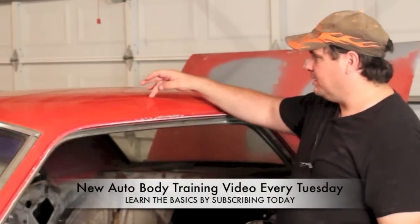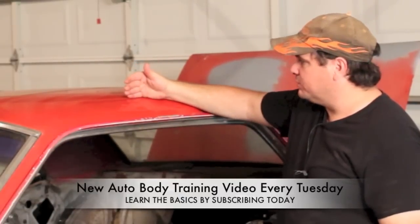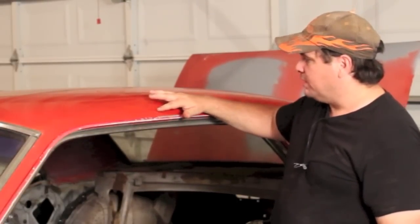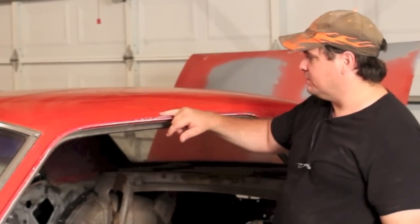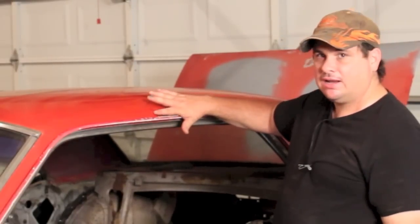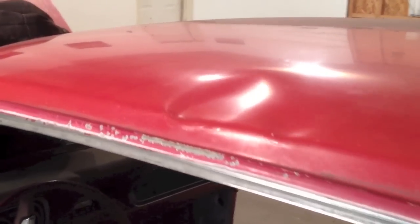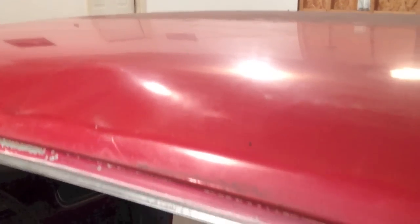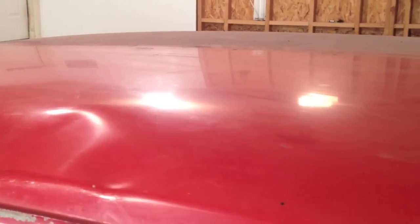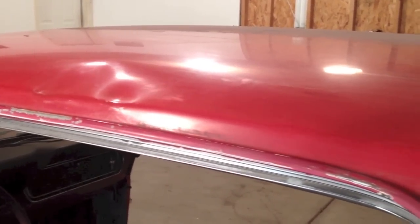You'll notice every dent has highs. Like in here, there's kind of an eyebrow, kind of a crown looking area. Those are going to be important when you go to pulling because you're going to want to push down on those areas as you're pushing up in those. Also, you want to pay special attention to this body line. You can't just pull up on this body line either because if you'll notice, it's pushing out right here. So we're going to have to tap that in, hammer that in as we're pulling that out. Now I want to show you how to locate and inspect your damage. When you're looking at dents, look at the lights - either artificial light or sunlight - and it'll highlight a lot for you. You'll be surprised when you look at the lights how it will highlight the damage, the high areas, that eyebrow there, and you can see the low areas. It really helps highlight that so you can see exactly what's wrong and know what to do.